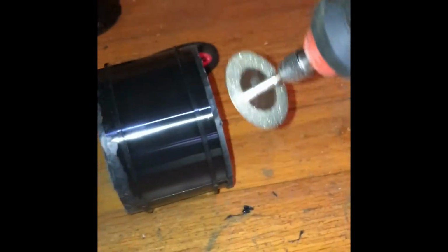So yeah, we used the cut-off wheel to eliminate the majority of the second bead, the outer bead. I was using the sanding disc, which I did for the first one, which came out alright, but I feel like the plastic melts off too quick, and this will become totaled before I do all four. So what I'm doing is carefully using the side of the cut-off disc to grind it down that way, and I'll show you guys how I did it. But so far, not bad.